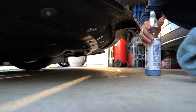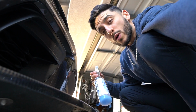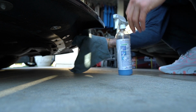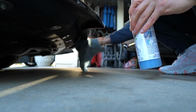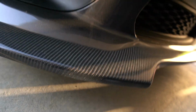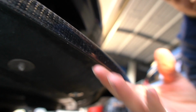So basically, the first thing I'm gonna do is I'm gonna clean this off. As you can see here, I got some of my little solution that I use. If you guys want to know what I use, go check it out down below in the description. I'm gonna just clean this off real quick, make sure everything is clean down here, so that when I put this double-sided tape SLIPLO skid plate on, it stays on. Now with this specific lip, if you guys can see underneath here, it's not all flat. You see how it's like, it's up like this.